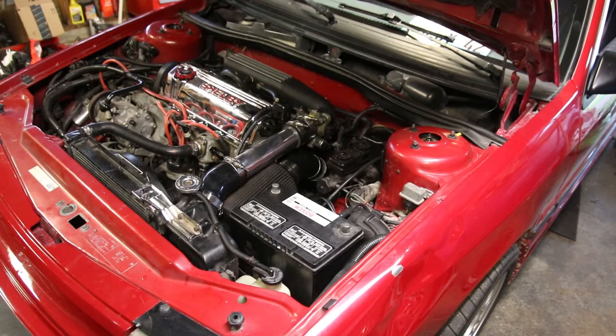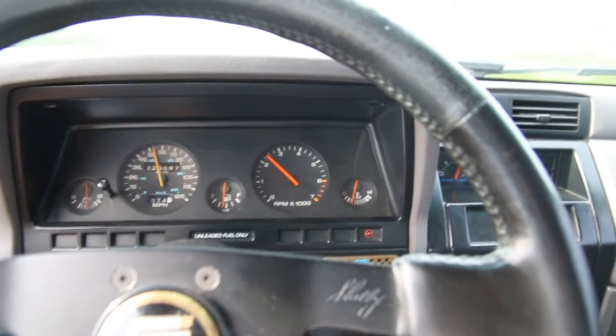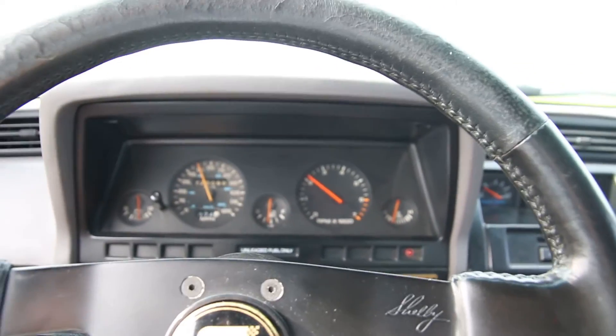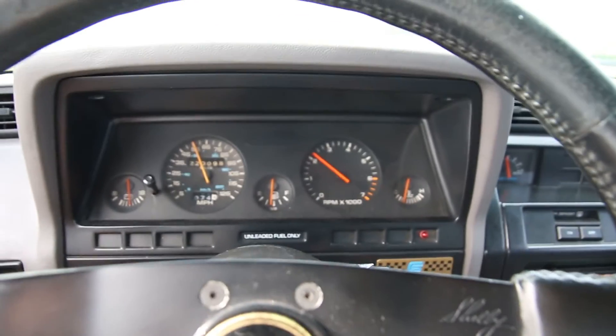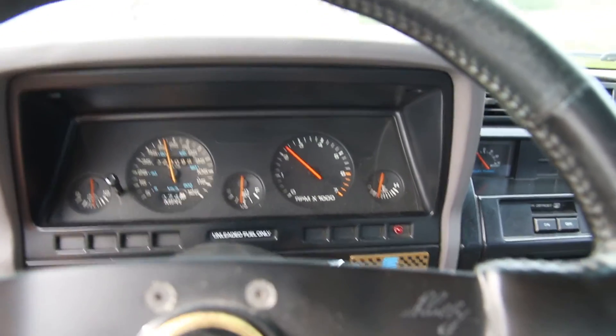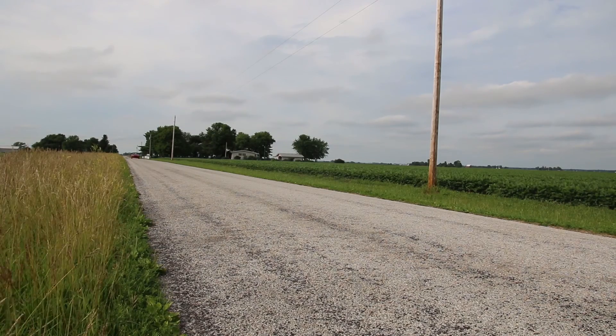There it is — back in all its glory. New turbo on, significantly larger than the one that came off. Should breathe a lot better on both ends. Out on the road the car is making a little better off-idle power, just because the larger turbo isn't choking things down — you can feel it breathing more freely. The new wastegate with no boost control, plugged straight into manifold vacuum, is doing a great job of keeping the boost low. The highest I saw was 10 psi today. Overall verdict — is this better? Oh yeah, way better.